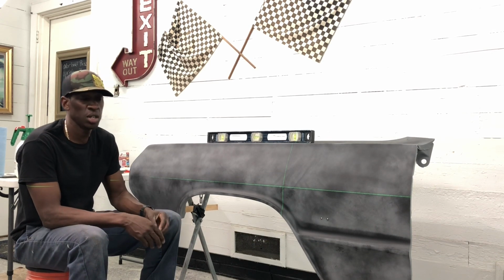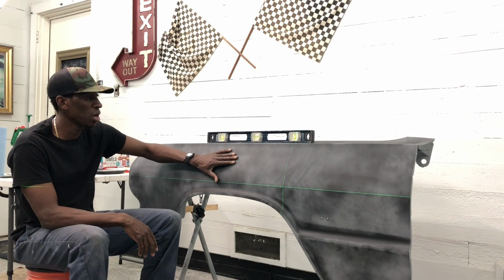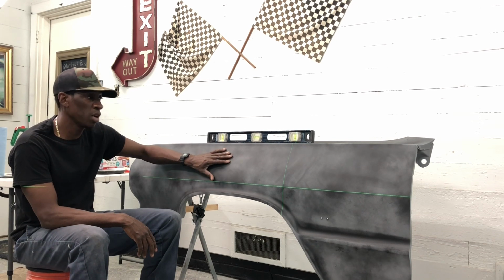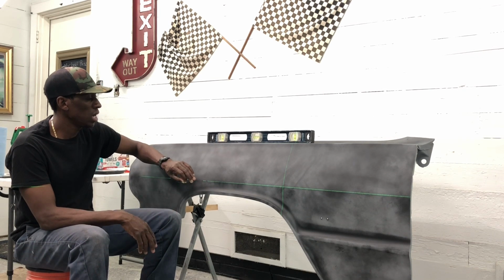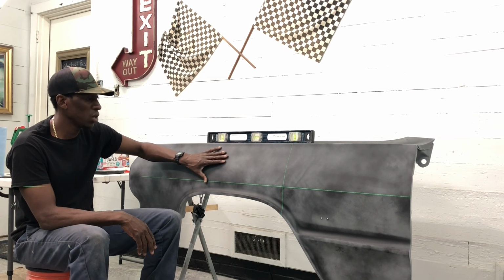And in today's episode, I'm focusing on a 64 Impala SS build that I'm currently working on. I've epoxy primered this, I put it in high build primer. I've let it sit for about a week to kind of let everything cure out and let it shrink, so I know kind of where we are. I've already sprayed this in guide coat.